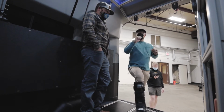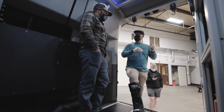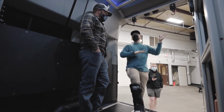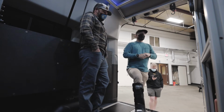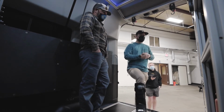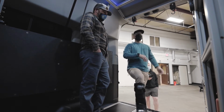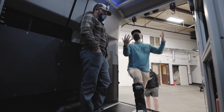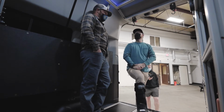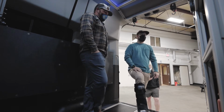Awesome. As soon as you park and turn off your key, that car battery is now settling down. It gets below that threshold, click, disconnects, we're not pulling from it. That's the most common scenario you'll hear it in, which is totally normal, it just means everything's working for you. But it'll do it for shore power, and from solar if it can get high enough, depending on what you're running inside of here too.